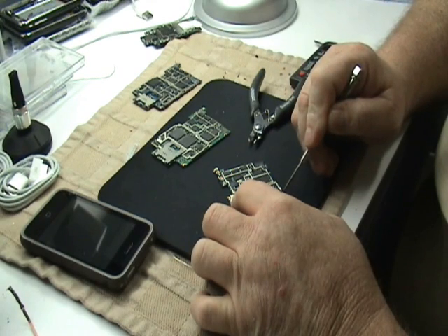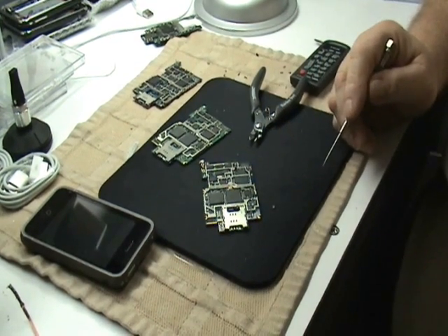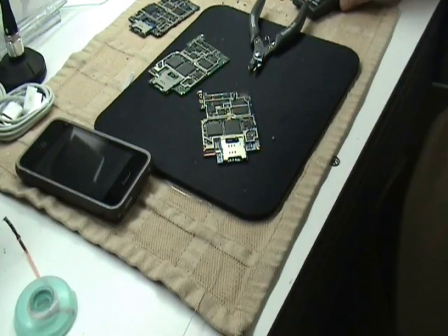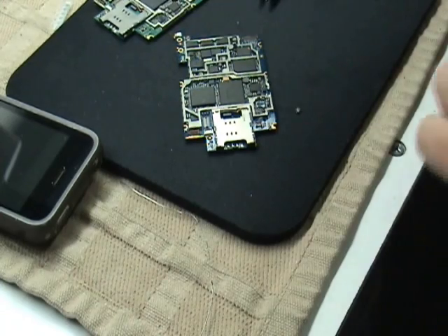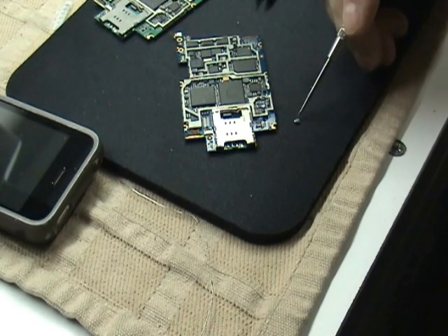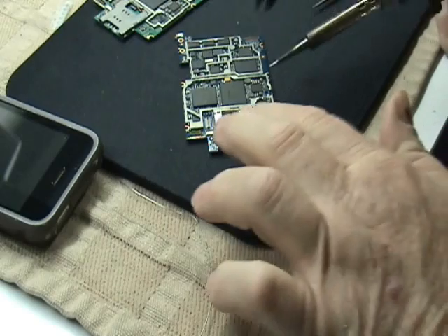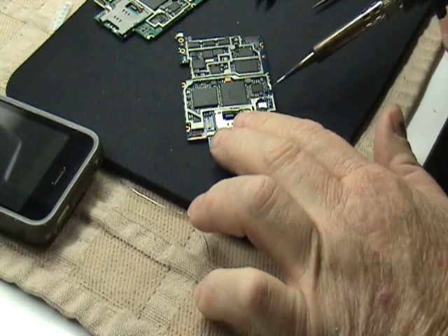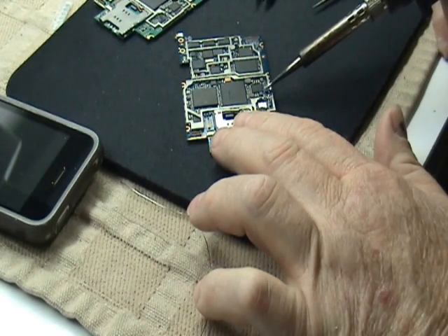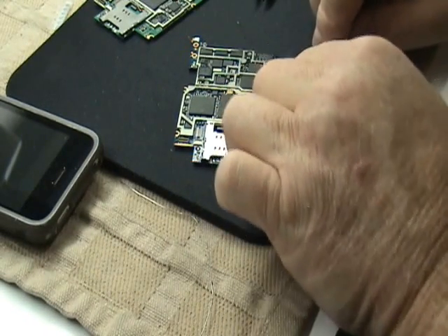What you've got here is this coil, and you've got to kind of put it in place. There are these two little metal pieces on each end that just stick down a little bit — it's wrapped around. Each of these is just going to solder on either side of this little pad right here. The solder's kind of sticking up high over here. It doesn't need to look pretty; it just has to be soldered on there. We're not going for any beauty contests here.